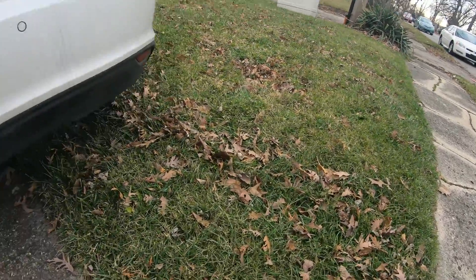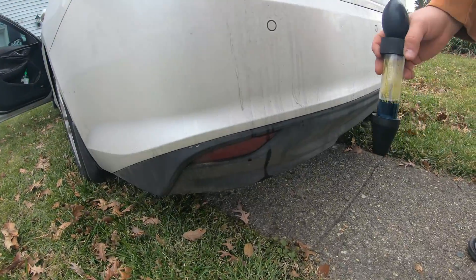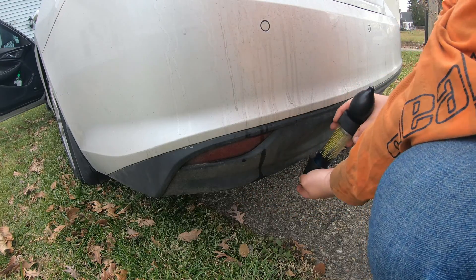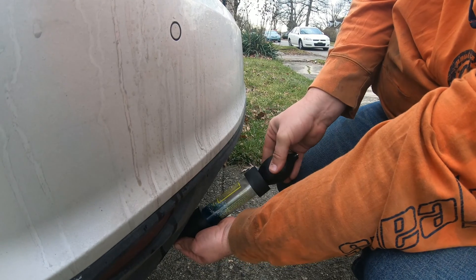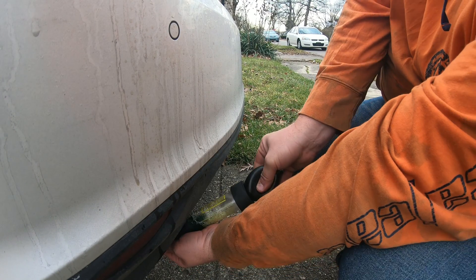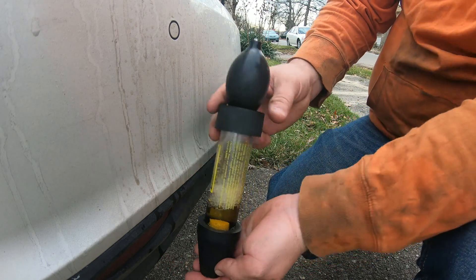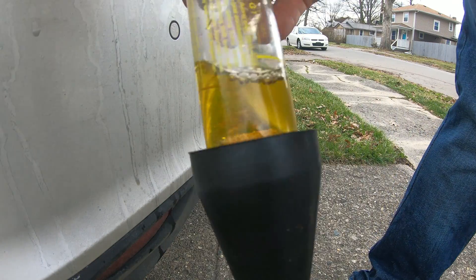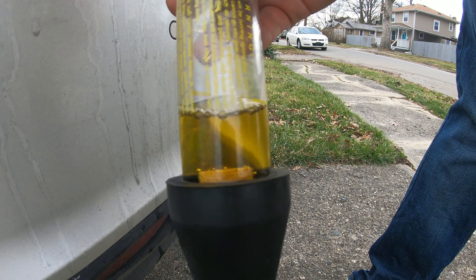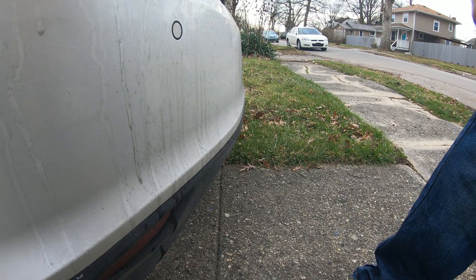Find your exhaust — don't forget which side yours comes out of. Put the tester pretty close to it and you should be able to suck the exhaust in and it'll change colors. You see that? It's pure yellow — because exhaust gas goes through, just like combustion gases would through a leaking head gasket. So if you had a leak, the test we just did before this would have gone from blue to yellow. Thanks for watching.